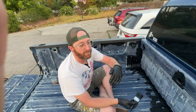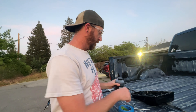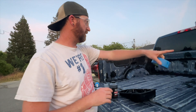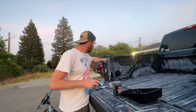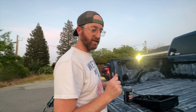So the first time we mixed the two parts together we had trouble with it not fully mixing. What happened was the bed liner itself had a chunk of rubber in the bottom — particles inside the paint that give it texture. This time, before I mix in the hardener, I'm going to take the lid off and stir it as best I can using this tent peg. We've already done some of the cutting in with the brush, so I'll start fresh on the remaining areas — around the tailgate and the top rail — then tape off and roll the rest.